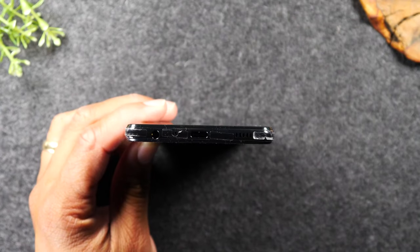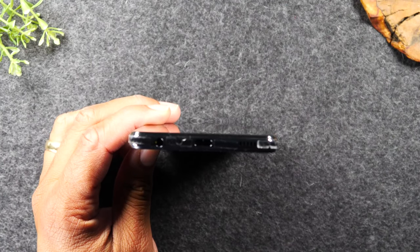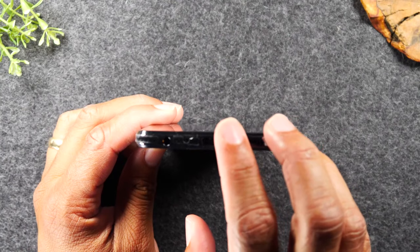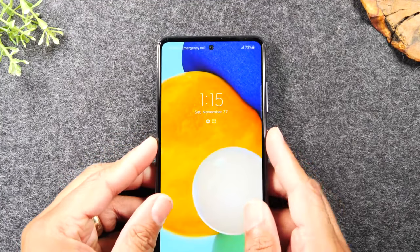You can also put in your micro SD card from an older phone and have all those pictures show up on this new phone. If you can't find the SIM tool in the box, just find a paperclip, bend it back, and it will also allow you to open up the tray. At the bottom of the phone, you will find the charging port. This phone uses a Type-C charger, so if you need to buy a replacement, look for a Type-C charger. In the video description, you'll find a link to our best accessories for this phone, including replacement and longer charging cables. The phone also has a headphone jack, so you can plug in your traditional headphones.